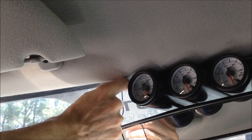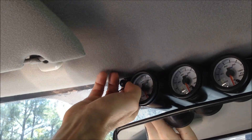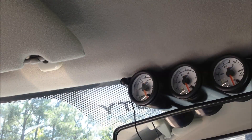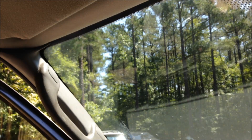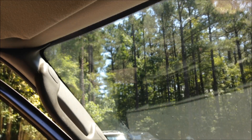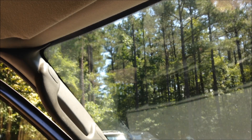I'm going ahead and installing the microphone. This microphone is kind of neat — it's part of the stereo kit and it has a little U-clip. I'm going to slide this behind here and stick it up on top, then run the wire up behind the headliner and down the side trim all the way over to the dash and over to the radio. I think that's a pretty good location for the microphone. This stereo actually has some sort of sensitivity adjustment for the mic, which is kind of good. Just a couple more clips and that's it.